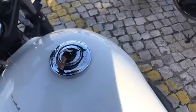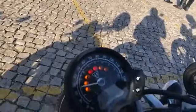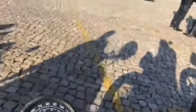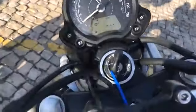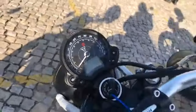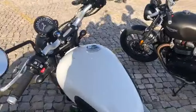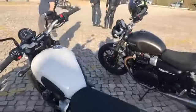But where this differs is that while the Street Twin only gets two riding modes, this one gets three — including the excitingly named off-road mode. This wasn't announced at Intermot; it was only said to have two riding modes. But in fact it now has three: rain, road, and the new off-road mode. The off-road mode keeps the same throttle map as road but deactivates ABS and traction control completely, which is exactly what you want if you're planning on taking this bike off-road.